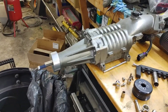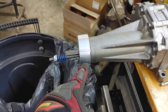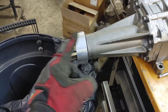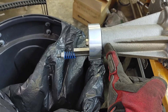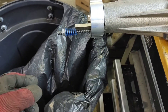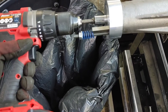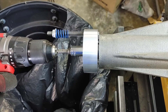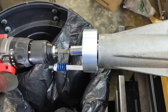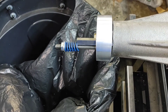I had the supercharger off to do the 2.6-inch pulley. There weren't any videos online showing the snout machining process, so here it is. This little tool from ZZP threads onto the supercharger after you remove the pulley. It machines the snout back about an eighth to a quarter of an inch — just enough to fit the smaller diameter pulley. I've got a 13mm socket chucked up in my drill, going real slow. As you turn it you can see it peeling off chunks of aluminum. Once chunks stop coming off, you just hand-tighten the tension and that's it.